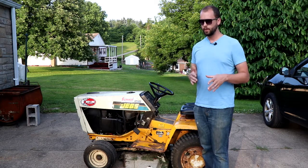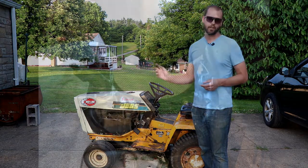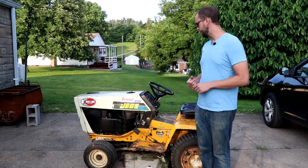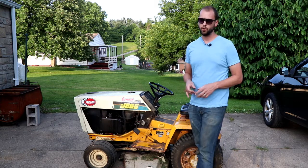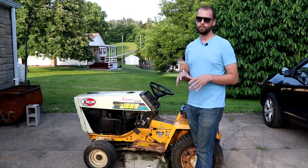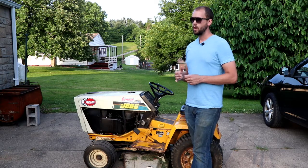That's a quick and easy way to tell which it is. That's not to say you shouldn't replace your air filter if you haven't done so in a while. If you pull the choke and it runs worse, the answer is simple — swap out your air filter, let the engine breathe a little better, and that will probably fix your problem.